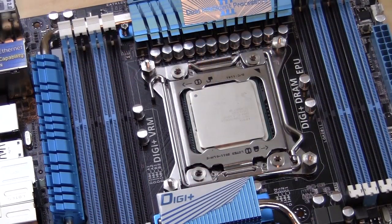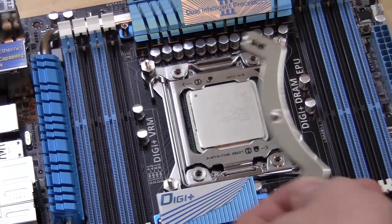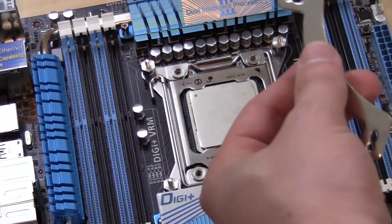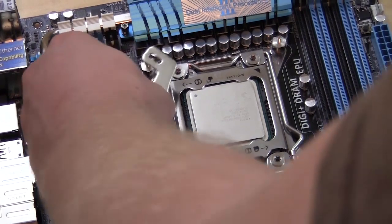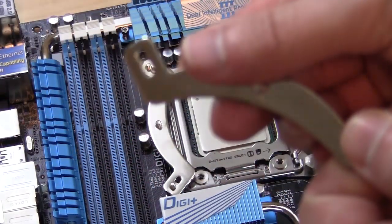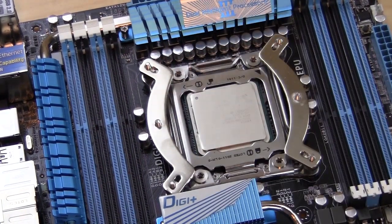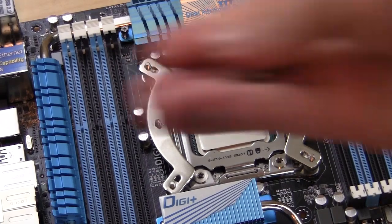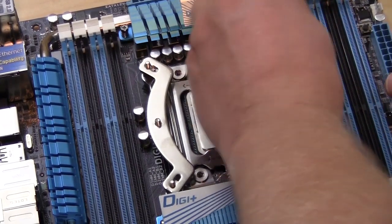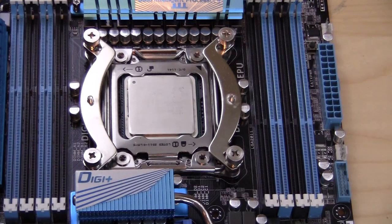Your socket should look something like this — you have the four bolts installed. Now we want to install the mounting bars, and the thing to remember is that they're going to be facing out and the little screw part is going to be facing up. So just out and up — that's what you want to remember. For socket 2011, they go on the last hole. Once those are on, secure them with the four included thumbscrews that simply go right on top. This is what your setup should look like so far.